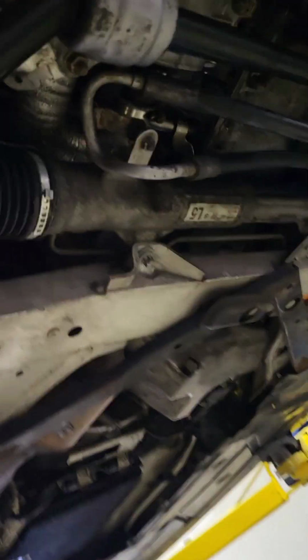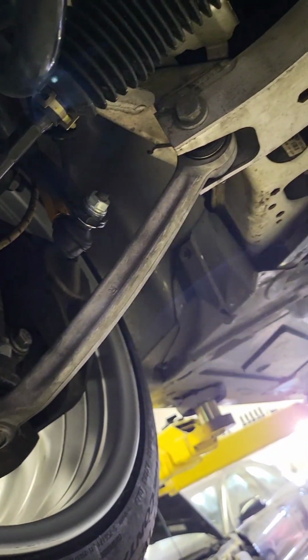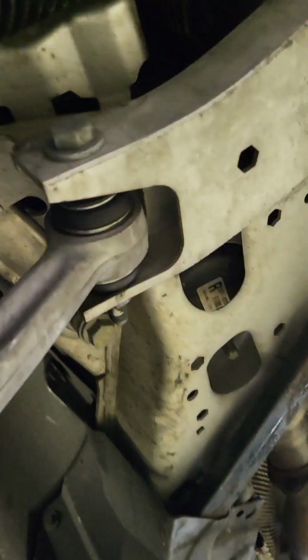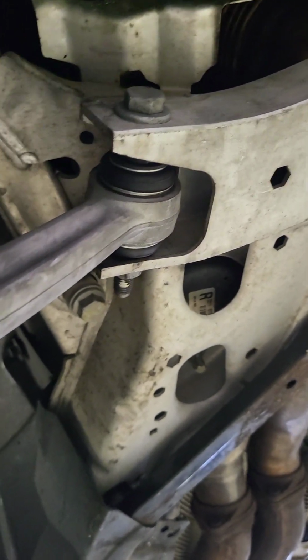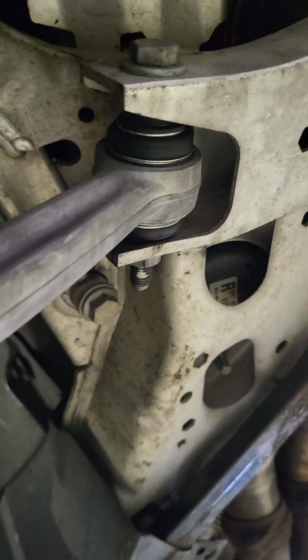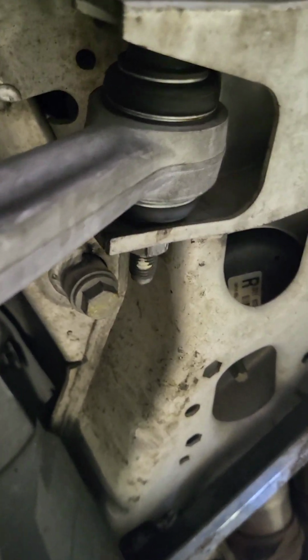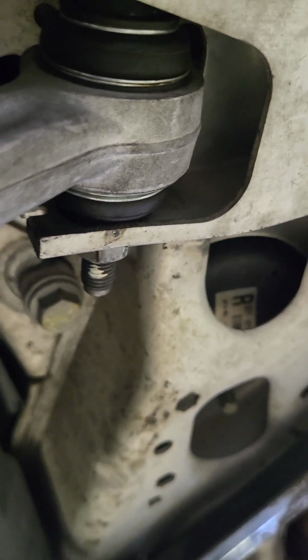And upon closer inspection, this car has an entirely new front suspension and rear suspension, but I swapped to 034 Density M3 control arms. So you got this unit here, and you got the rear control arm here. Let me see if I can pick this up on camera. When I'm tugging on the front wheel here, you can see this abnormal movement on this guy right here. This bushing is bad.